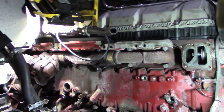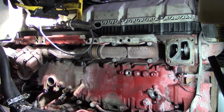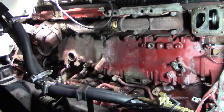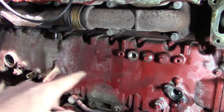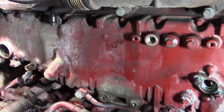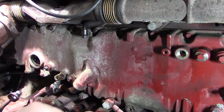I believe it used to be an old tanker truck because the fifth wheel was all welded in place. I just put a radiator in it. It's been leaking oil real bad since I got it. What we came up with is the oil core here — this whole big unit here — it's leaking oil pretty bad back here. And at the bottom here, the oil filter housing is leaking also. So all this is coming off. I'm hoping the core is not cracked — possibly, maybe — I'm not 100% sure yet.